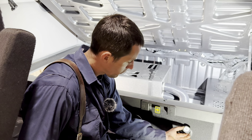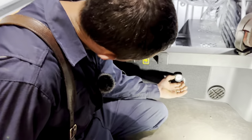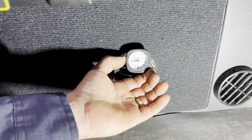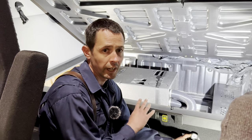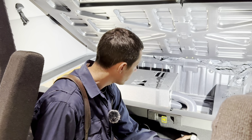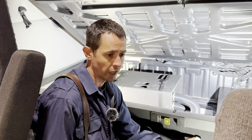I've had the unit running for a few minutes. I've got it on the lowest temperature setting and highest fan setting. On my thermometer, we're at just a hair above 40 degrees Fahrenheit — about 4 degrees Celsius. The unit here is rated at 8,000 BTU, or approximately 2,200 watts if you're looking at cooling capacity. We're going to go down to the battery bank and see what we're pulling in amperage at the highest setting.